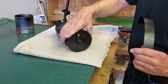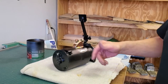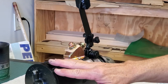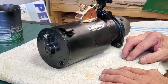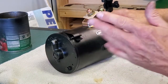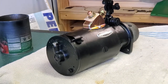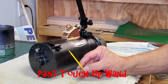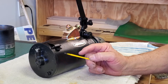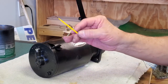Here we have the original band that goes around the starter to cover up the openings or windows. Here we have our band installed on the starter — you'll notice it has a clasp that is fairly hard to get on, and it should be so it will stay in place. No matter what you've done, you've probably scratched something or found something not perfect on your paint. Instead of automatically powder coating, you're better off rattle-canning something like this because you can touch it up easily using paint touch-up wands. Spray your paint into your cap with your rattle can and use the wand to touch up places easily.